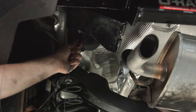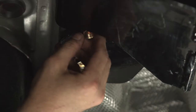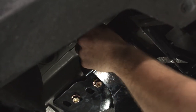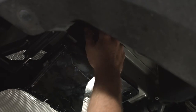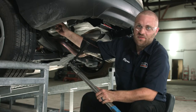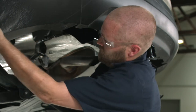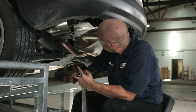Back here on our driver's side, we pulled our fish wire through our attachment points and now we're going to remove them and attach our flange nuts. Now we're going to do the same thing on the passenger side. We're going to use a 17 millimeter socket with an extension and our torque wrench to torque the carriage bolts we just fish wired through down to specification. We're going to remove the extension so we can get into that side bolt.